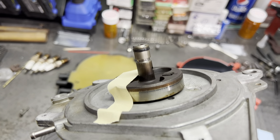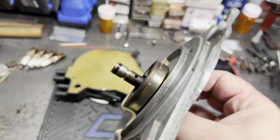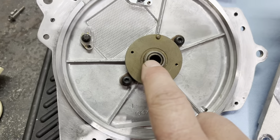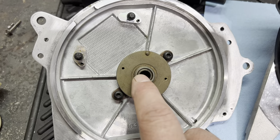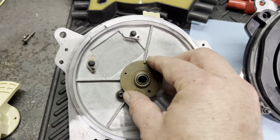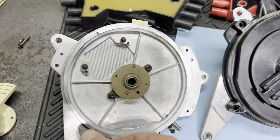The hub has a shaft that goes through the distributor body — that's the small hollow shaft — and they press this hub on. As soon as they press that hub on out of clock, it's game over.